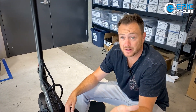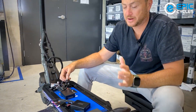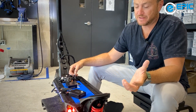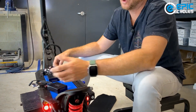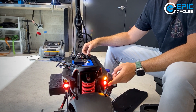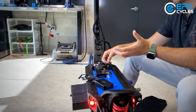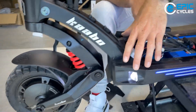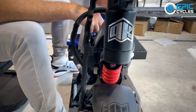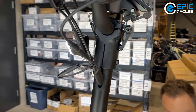I rejigged the wires — there was a lot of trial and error until we got it correct. But essentially, there are eight cables here that affect eight different lights. In the rear alone, we have four: your brake lights on the bottom and your signal lights up top — four different wires that control this. And then in the front, these blinkers — the front spotlights or signal lights — are another two. Plus you have your front headlight and horn. So that's eight wires.